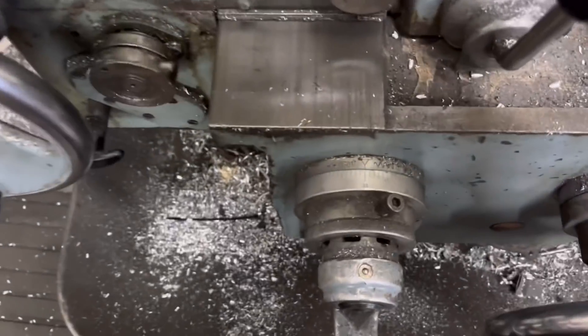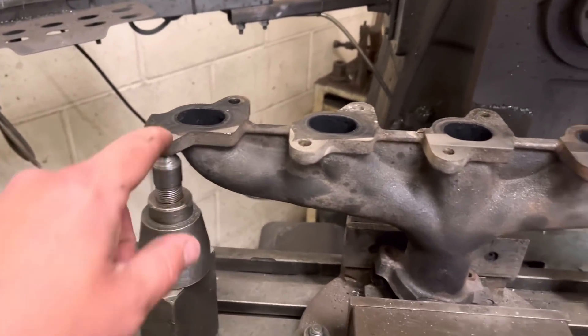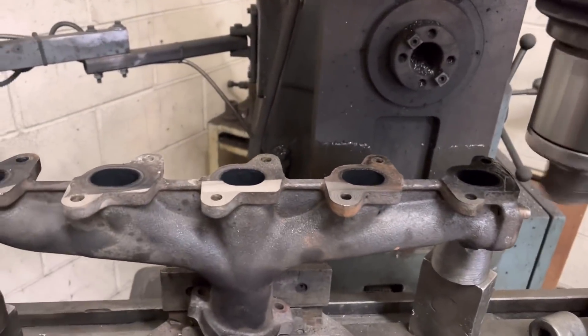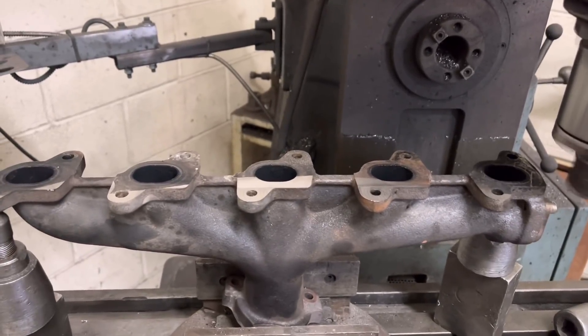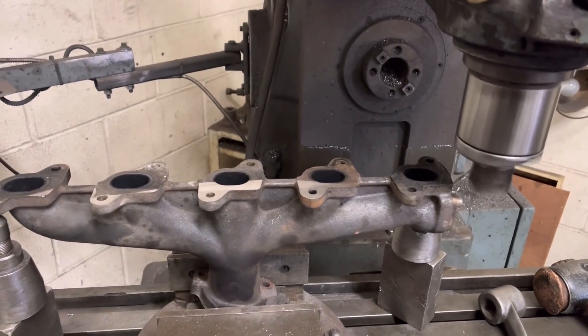You can see for yourself guys — that's 30 thou there, so that's three quarters of a mil. We hardly even started touching the end here — just literally there — then started touching the back. So that is bent like a bloody banana. I'm expecting getting on a couple of mil will clean this up. Well, that's it from us guys for another week — we will see you again Monday. Have a lovely weekend, subscribe, like, hit the notification bell. We'll see you again, cheers!